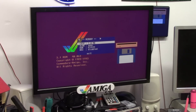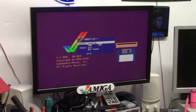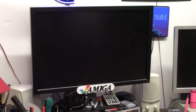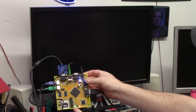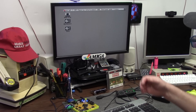I'll just leave it on 2 megs of chip. If I go to the right again I will have my number of drives, the speed, and I can turn the 600 IDE off or on. If I press this on, I can select which hard file. I scroll all the way to the bottom and hit save, then reset. So resetting the Mini-Mig with the master enabled — you can see the hard drive loading here on the green. It will load a Workbench, and after several long minutes you can see that it loads into a Workbench, which I have no memory left.